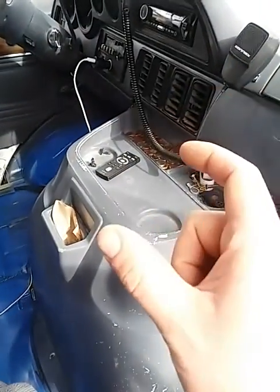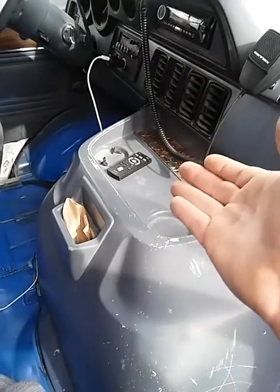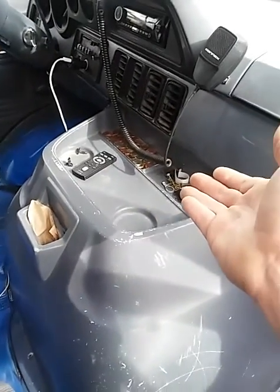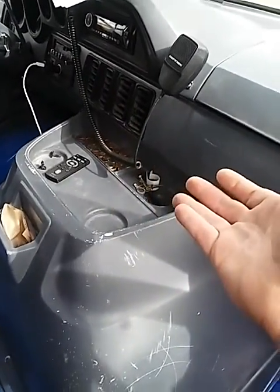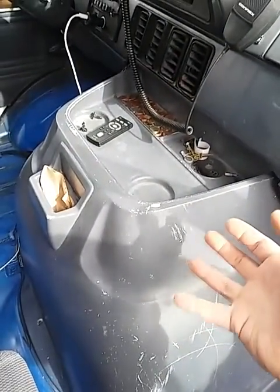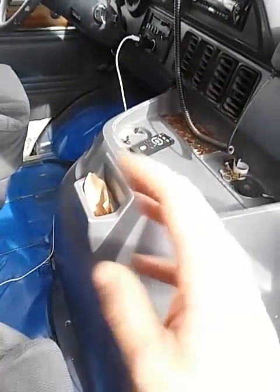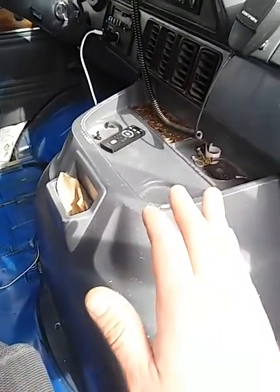and then put the stock one in that I actually thought was kind of bad, because I figured, well, if I'm going to replace the temperature sensor, I might as well change the thermostat, save myself some trouble. I'm already under the doghouse. Why not go ahead and do it? So I went ahead and changed that out. Didn't work. Overheated. Almost killed my motor.